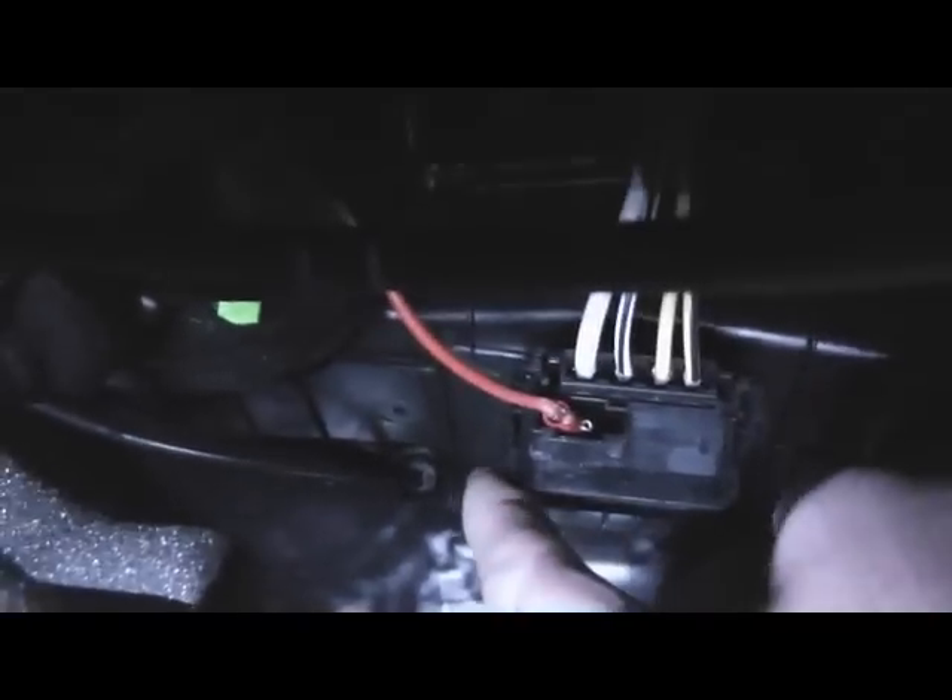Now that will reveal — if I can see — that there is your end stage resistor for the blower. Let's get it out. It's just a case of squeezing the two lugs together, here and here, squeeze the sides, and pull it out like that.